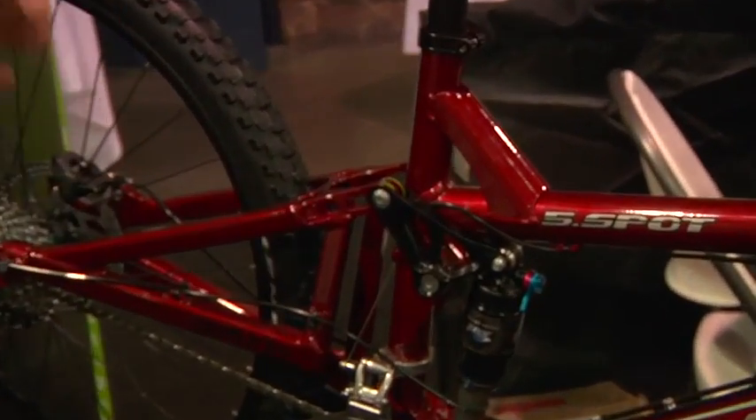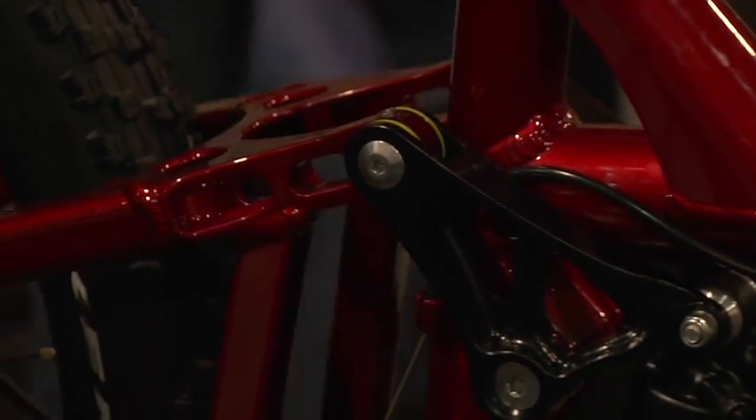We use grease fittings — new for 2009 and carrying through into this coming season. We are using custom-made stainless steel threaded grease fittings. We've been using grease fittings since the very first production bike, but a little over a year ago we designed and had manufactured stainless steel grease fittings that have threads on them instead of just tapping them into a press-fit hole, which worked most of the time. But with these, you can use high pressure on your grease gun to force the grease in without the grease fitting popping off.